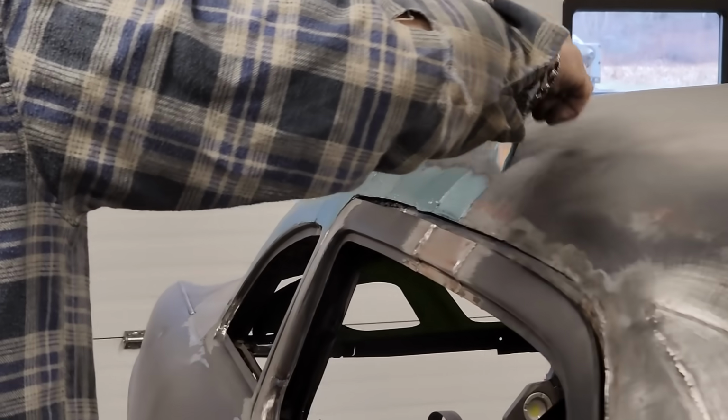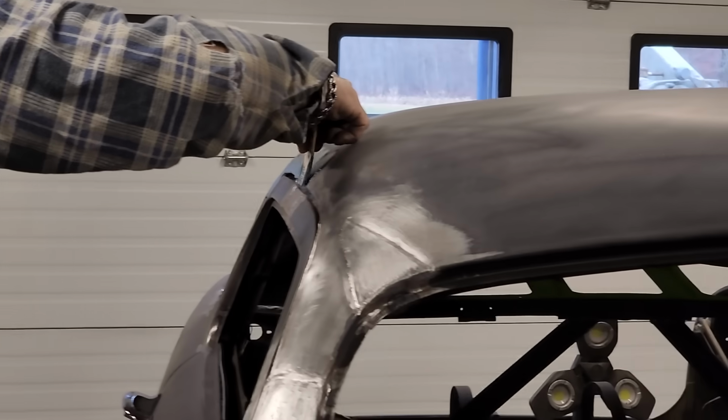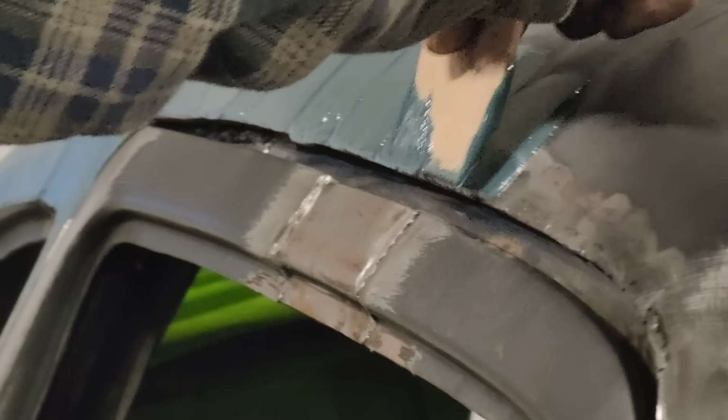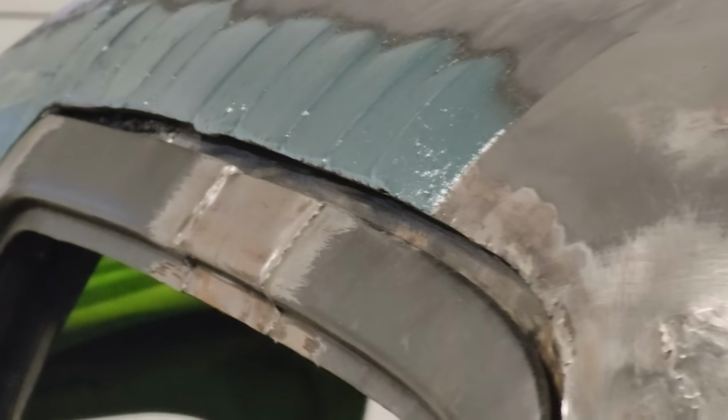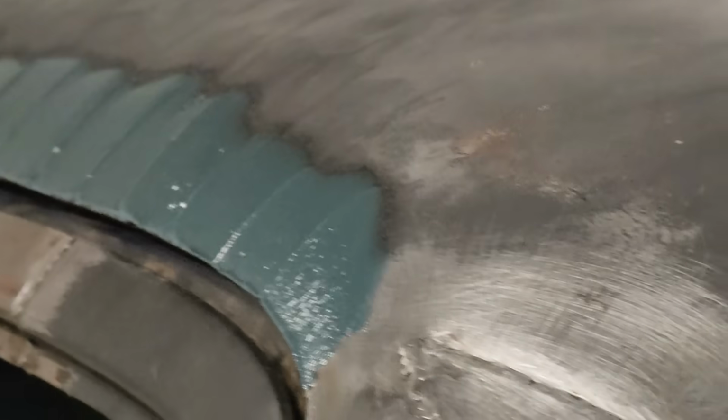This is a hard place, or not a good place, to weld. It spits and sputters. I'm not sure what's in between the welds, but we cleaned it and welded it the best we could all the way. The only time we'd spot something, I guess, would be maybe in the floor or something like that, and then you'd want to seam seal it after you're done. Yes, you would.